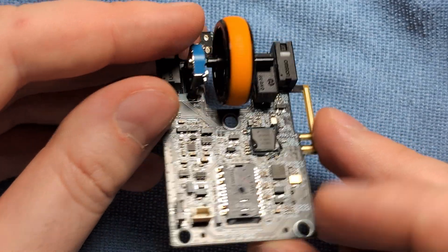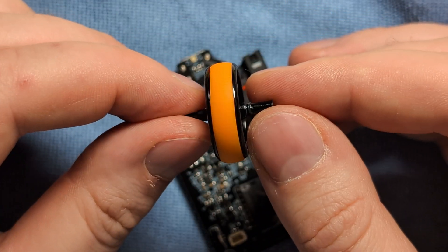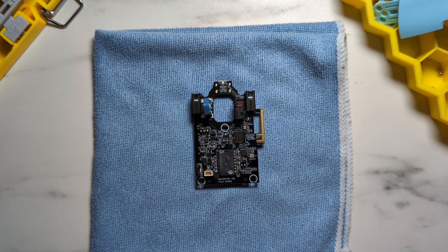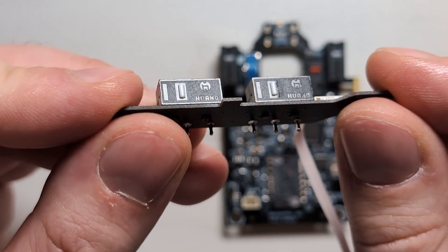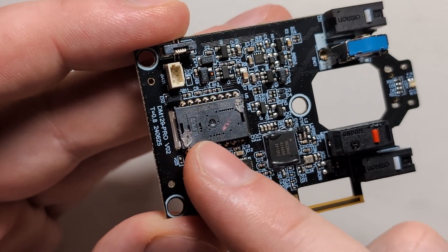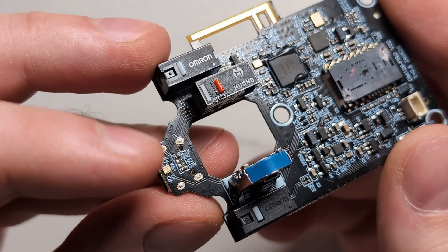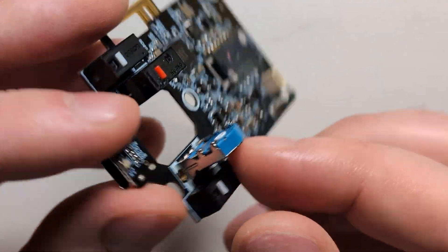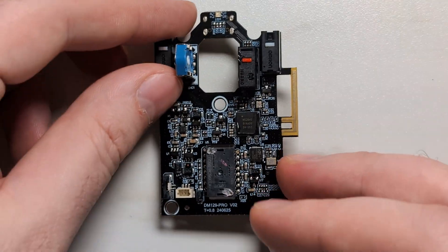Lastly, we have the main board. We can remove the scroll wheel by grabbing the side of the encoder and pulling to the right — the wheel pops off just like that. That's pretty much everything for the disassembly of the S1O — a very, very easy to service mouse. In terms of the boards, we have the daughter board with the 210 white dot switches for the side buttons. On the main board, we have our Pixart 3395 DMT-6QU sensor, our Nordic 52840 MCU, Omron switches for the main buttons, the Level 210 red dot switch for the scroll wheel, and a TTC 11mm encoder for the scroll wheel — a simple, decently weight-optimized board.